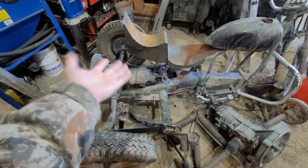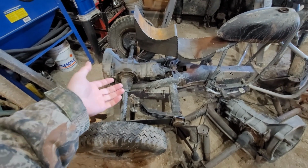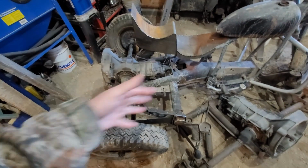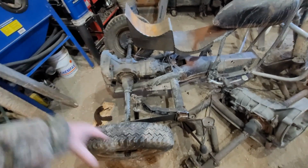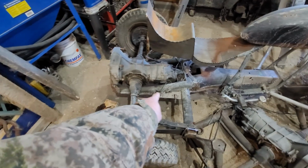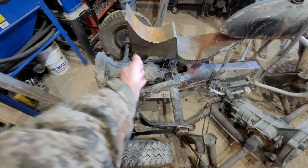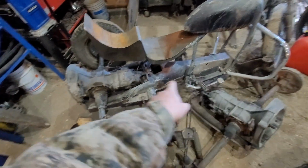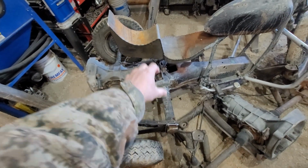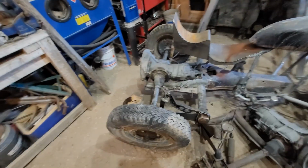Do a mid-engine swap. So basically the differential has to be flipped inside the case, and then you're flipping the whole case by unbolting it, turning it. It's a long process. You're cutting down these guys here. So then the transaxle would bolt up, and the back of it would stick out, and then I could have a front connector with a shaft to gear it down if I want to use a small engine.